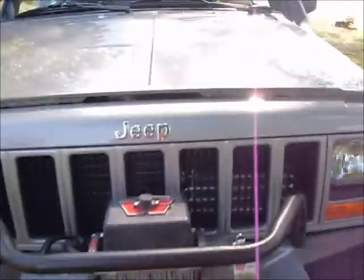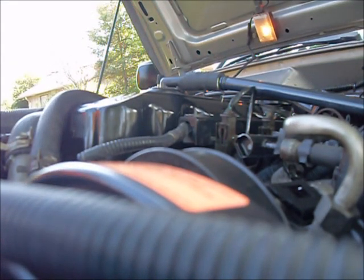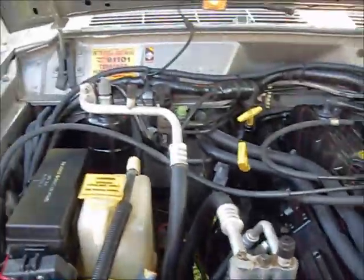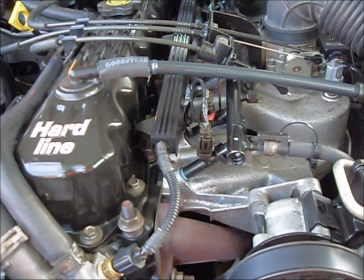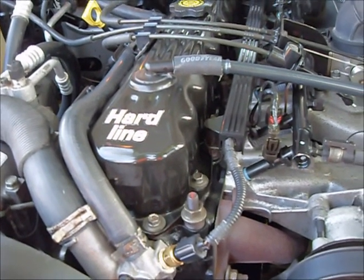Here's the winch cover for the winch. Getting into the engine — I built the engine last year. It's got a brand new 900 cold cranking amp battery; I went with the bigger battery. New compressor. Lots of new parts — I totally rebuilt the engine with new pistons. I had the block out to the machine shop, it was honed out and checked, and I had the pistons and rods all sized and put back together.